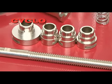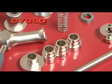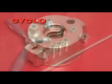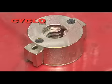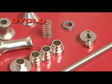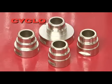The unique reversible guides allow the user to simultaneously ream and face the head tube, or reconfigure the tool to face the head tube without reaming. Included with the tool are all the head tube guides needed to prepare 1 inch, 1 and 1 eighth inch, and 1.5 head tubes.